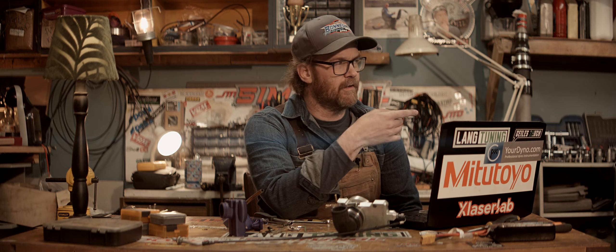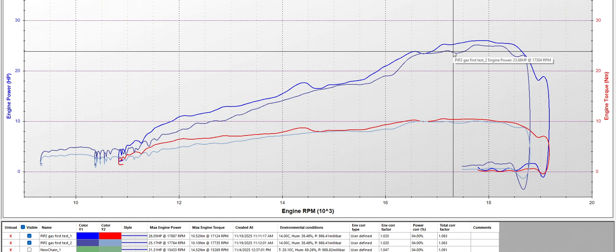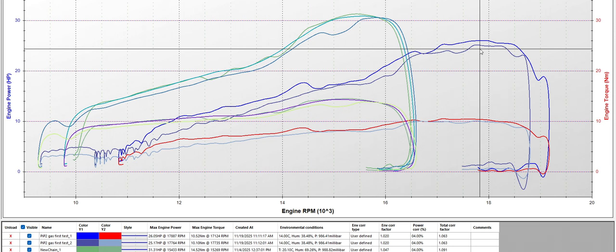Immediately clocked in 26 horsepower with a random jet, unconfirmed timing numbers, and a 17 millimeter — probably too large — stinger. It quickly dropped to 25 for the second run. The graphs are like this, and that's probably vibration and fueling issues. Success — everything's working like it should. Now with the hotter-burning fuel the power band has shifted a lot. First priority: confirm timing, get an EGT probe, and try the smaller stinger tomorrow.